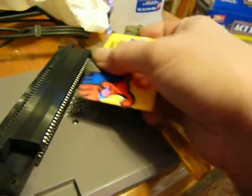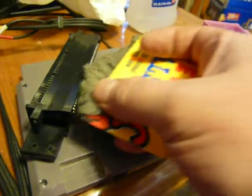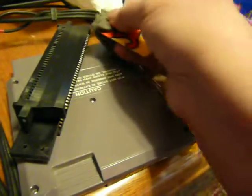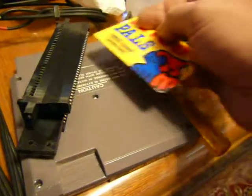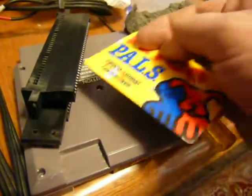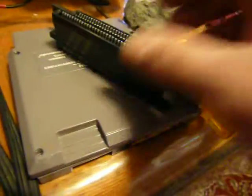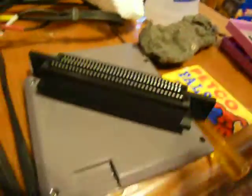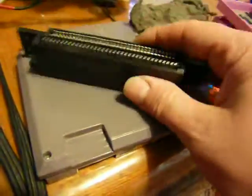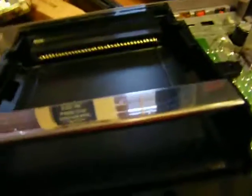like that, and then I shoved it in on the corner into the contacts, so that it was kind of like a sandpaper on the contacts. And so basically I just took it with that on it and I just sanded several times each little area, and then I blew it out, and then I soaked it in alcohol in a snack baggie, put it in, and then I shook it, and then took it out and let it air dry. And once I did that and I put it back on, you can see how shiny they are.